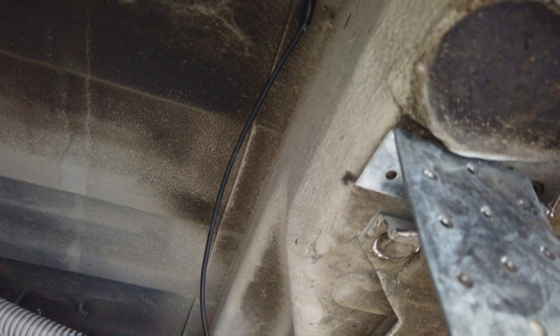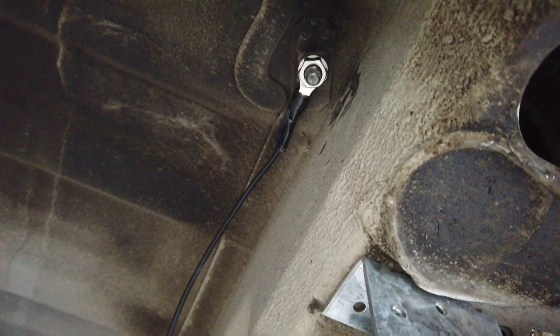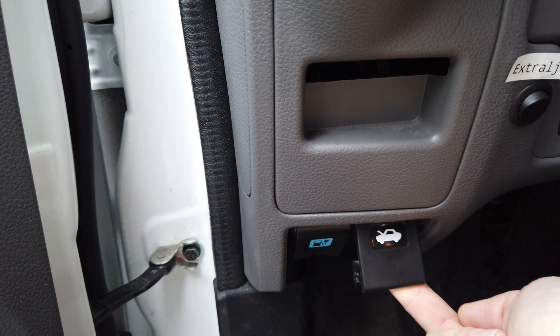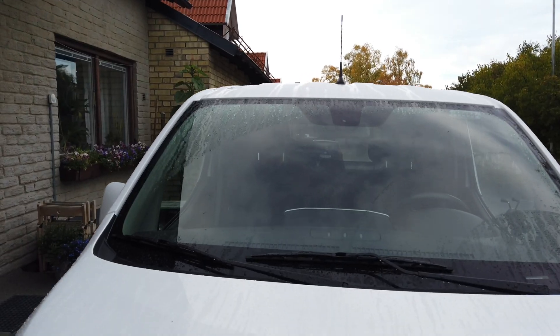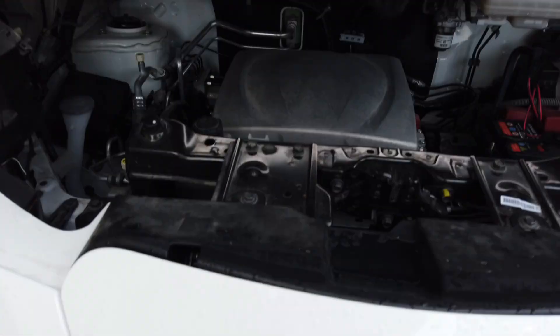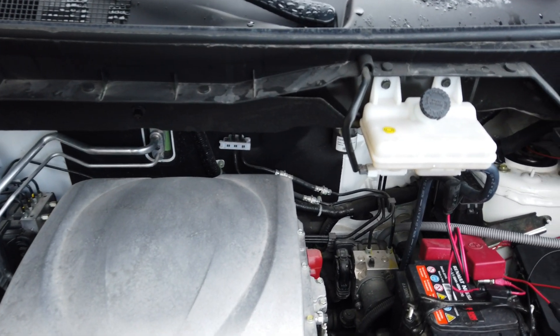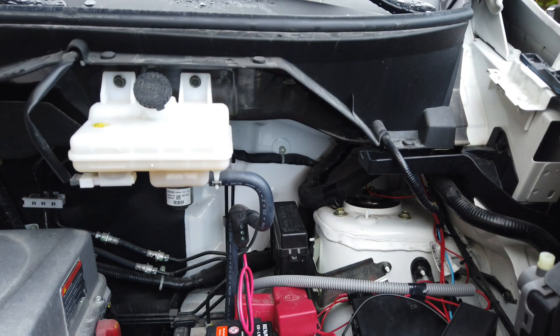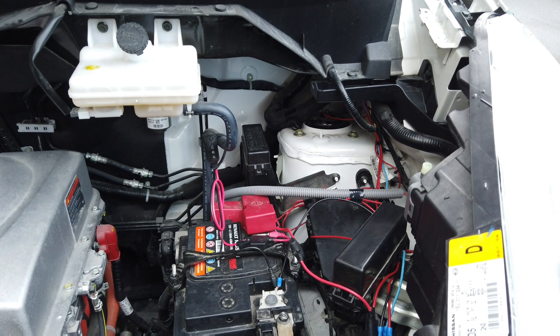Of course I have made a common ground and I found a pin I could attach it to. Look under the hood. You can see the installation here. This is the cable through the torpedo wall connecting the toggle switch with an ordinary 12 volt relay.